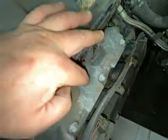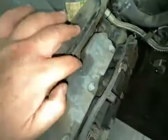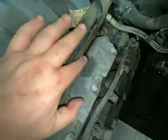For that issue, I'm going to suggest replacement of the valve cover itself, as well as the vent lines connected here. They're rubber lines that are going to become brittle, and once we remove them there's a very good chance they're going to break. So anytime we perform that valve cover repair, we always replace those vent lines.